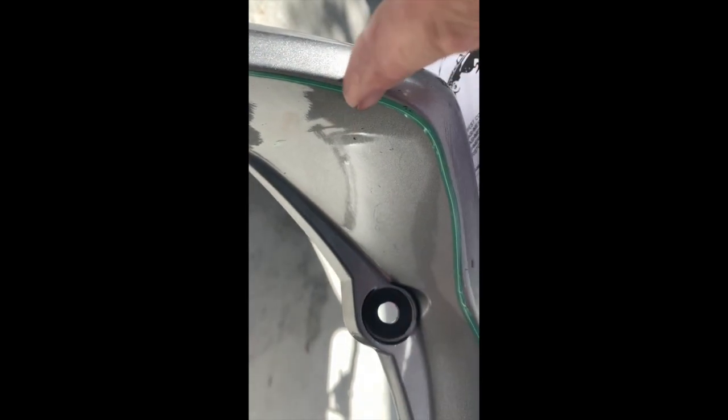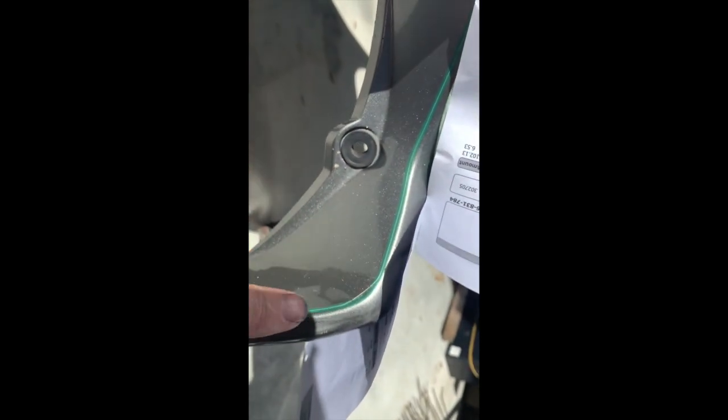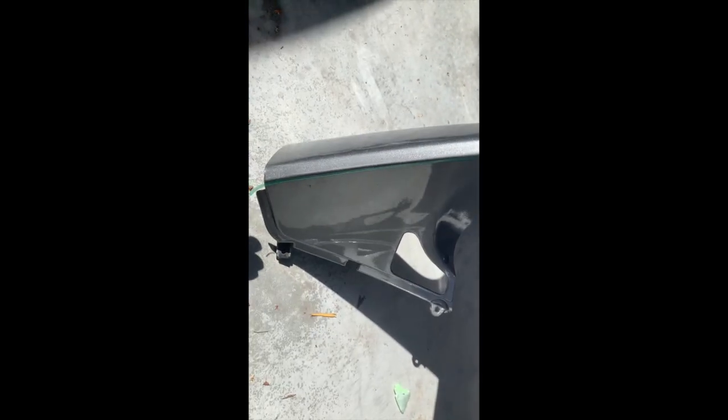Knifeless tape. Following the contour, now one thing I've learned is that it doesn't like being there. You can see this one here, the tape can come away from the wires coming from the tape here. So not so easy on curves. Great idea though. The idea is you put on the wrap and you go over the tape, and then you grab the end of it and you pull it off, and it cuts the wrap nice and neat. That's the theory. We'll see how that goes.